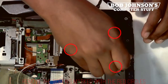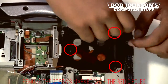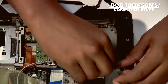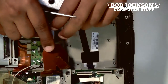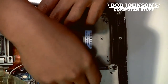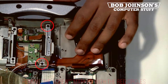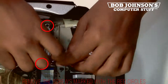We are going to remove the part here by removing the screws marked with the red circles, then lifting the part out of place. Now we have to disconnect the two ribbon cables connecting to the system board and remove the wire connecting the bottom of the system board. We are also going to remove the screws for this part, which have been marked with red circles.